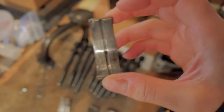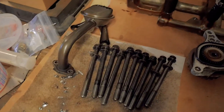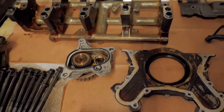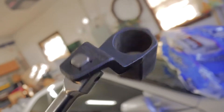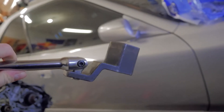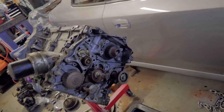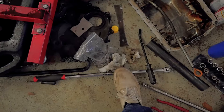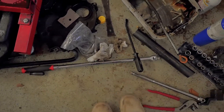It's very important to understand oil flow in whatever engine you're building, and if you can improve it before you put it back together, it's definitely a good idea. I had to use a crank pulley tool — a universal Honda/Acura puller for the harmonic balancer — because everybody has an issue with that bolt up front. What I did was hold it with this tool, have somebody on that 19mm nut with their body weight, and lock up the back of the crank with a couple of bolts.